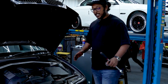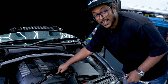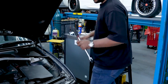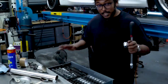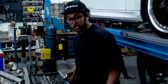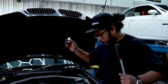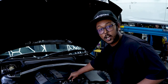Next is the oil change. First we remove the oil filter — it uses a 36mm hex nut, which is unusual. Even a full-fledged garage here only had a 32mm, so we had to hunt for a 36mm. BMW really does things their own way. We're going to break this out and change the oil filter first.